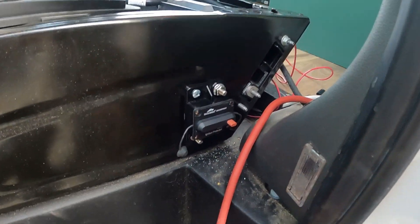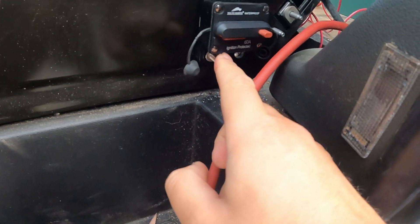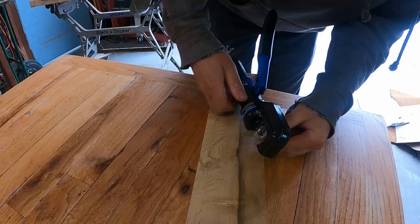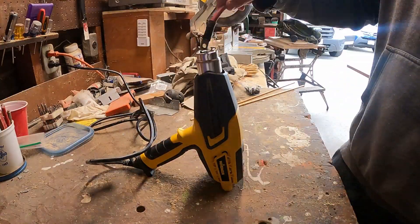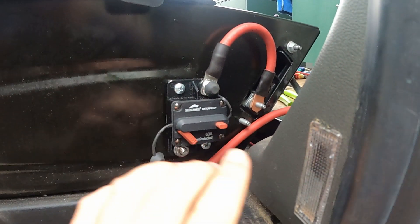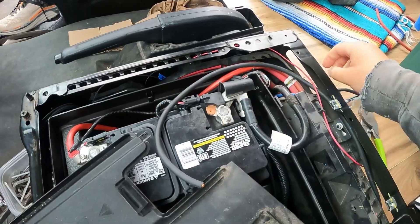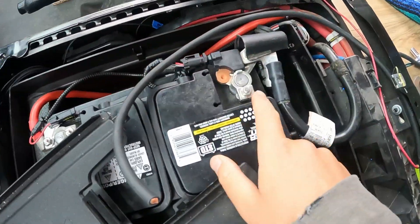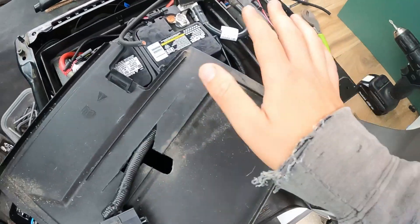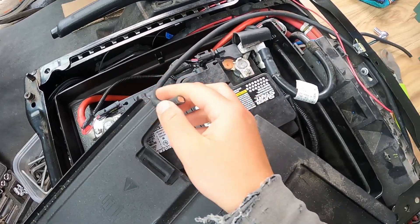Now that this is mounted, I need to connect our DC positive to the auxiliary, and then I need to make a new cord that goes from our battery side of our breaker to the CCP. Now I have my breaker attached to the CCP, and the next step is routing our negative wire just to the negative terminal of our battery. You can also just ground this wire, but I don't have an easy way to get to the body of the vehicle from here. I just got to crimp a lug onto this and heat shrink it just like I did all these.